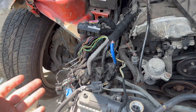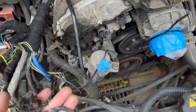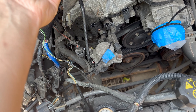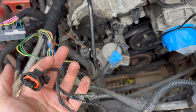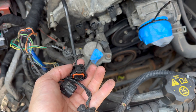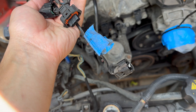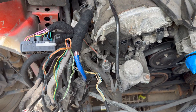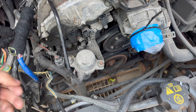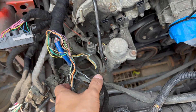Just like that, the wiring harness is done. I didn't cover these ones up yet because this one goes down to the bottom and these are all sensors — I unplugged them and forgot to mark which two of these go where. Luckily I found the service manual for the Camaro, so I just have to find out which wire goes to where — not a big deal. That's why I didn't tape these up yet; they need to be routed to their proper spots first.